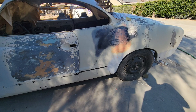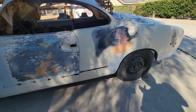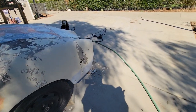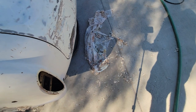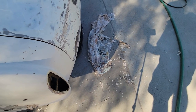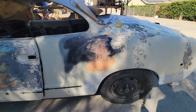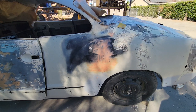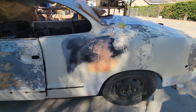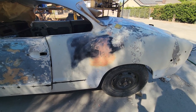Another thing I found is you can take your plastic that's got stripper on it and reuse it a few times — leave all the old paint on there. I've used one piece of plastic for two or three areas on the car. The stripper on the plastic, even with all the paint in it, is still active and will still remove more material. With other strippers the plastic would dry out and be useless, but this stuff keeps going. It's got some real benefits, though it also has its downsides.